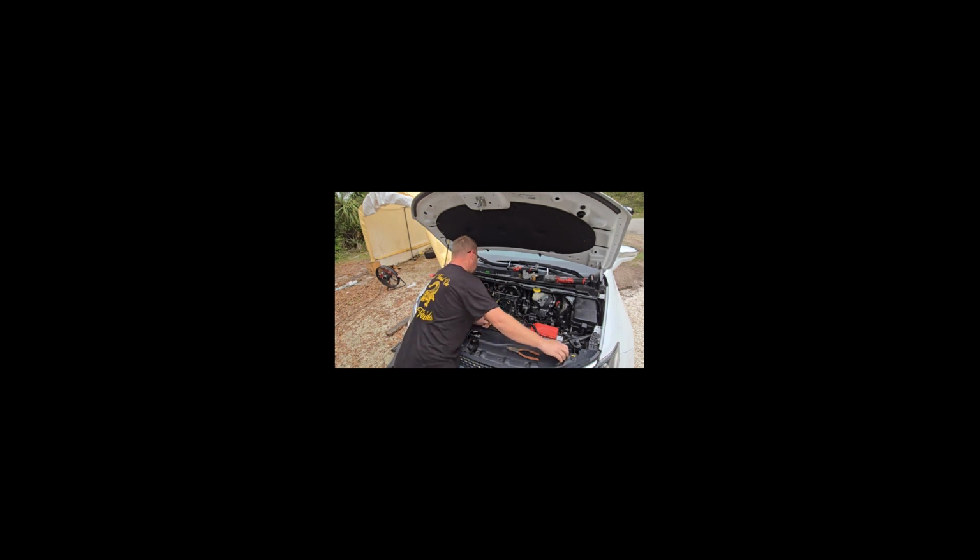But I'm gonna go ahead and take out cylinder 5's ignition coil and spark plug. Take a pick, angled pick, doesn't matter if it's 45 or a 90, get in there and pop that tab loose. Now in my experience with these newer style plugs, it's easier going from the front side if you can get in from the front side. Pull the tab up and pull it back. That is also a 10 millimeter. So I'll get something back there and get it out.